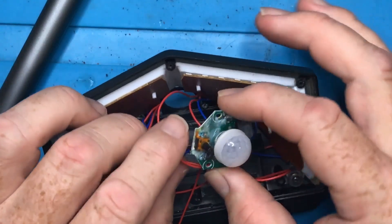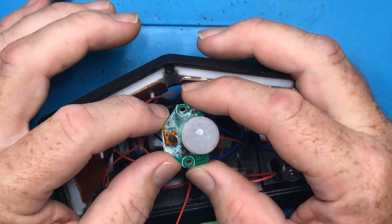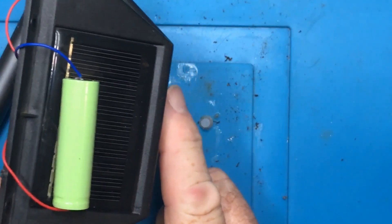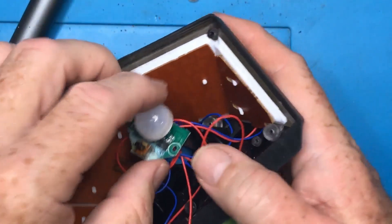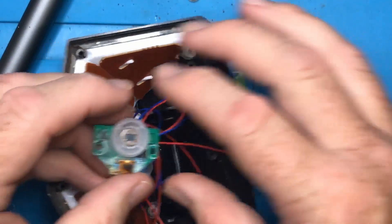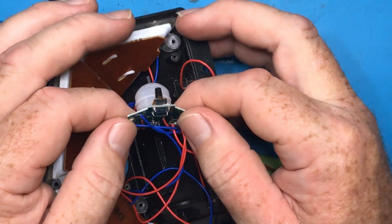Okay, so there's our problem right there — water has apparently gotten in via the mode button. Now, if this thing was sitting on its side as intended, the water would go a different direction and it did have a little waterproof grommet on it. So water either came through there, or through here, because this other point doesn't have a waterproof grommet on it, just a lip — and that's just a plastic thing that goes over the sensor. So water got inside, and I'm not surprised at all because it was sitting the wrong way instead of on its side.